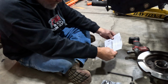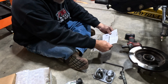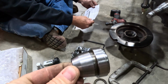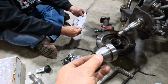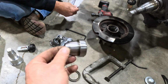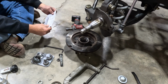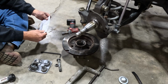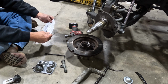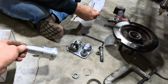While he's ciphering, what he's got here is a DRP bearing spacer installation tool. If you use these bearing spacers, like we do, you put this thing in your hub. It's between the front and the rear bearing. And you take it on and off about 14,712 times, back and forth until you get the exact spacing you want with no drag but no slop in it. So what this tool does is it allows you to, there's your fixture.